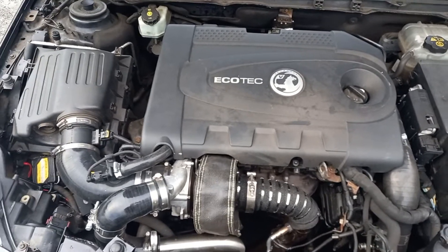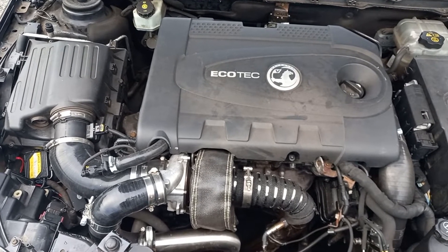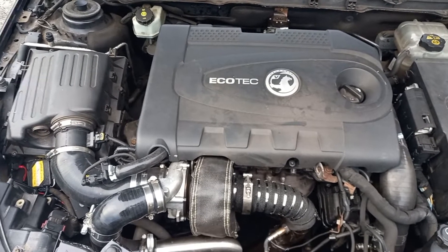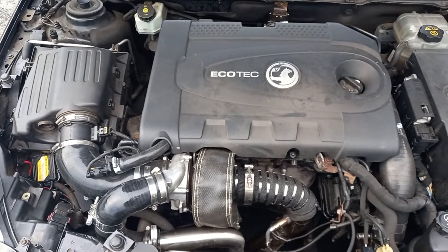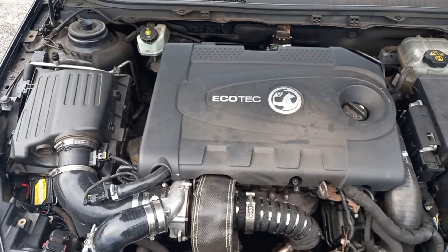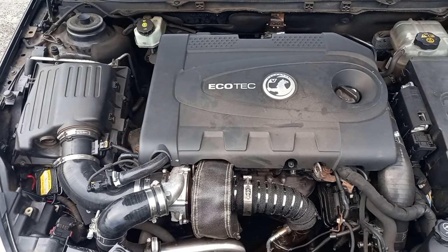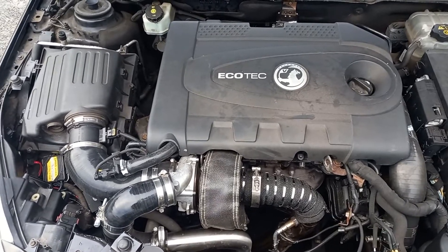While doing the pull, we logged where the boost was coming in. I'm very pleased to say we had a 50 RPM improvement — the vehicle basically started to get boost 50 RPM earlier than it did without the blanket and the wrap. As it moved through the rev range, the improvement was quite pronounced.